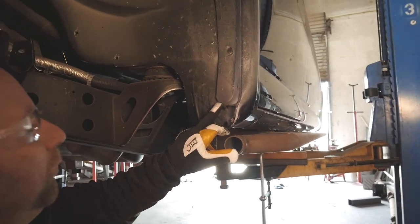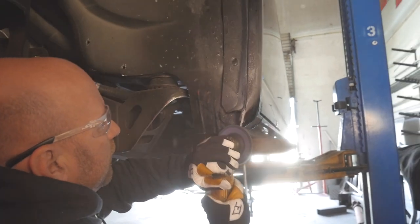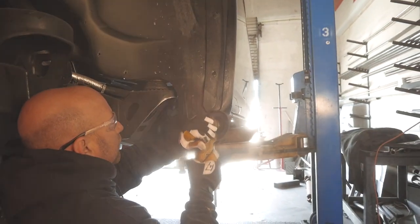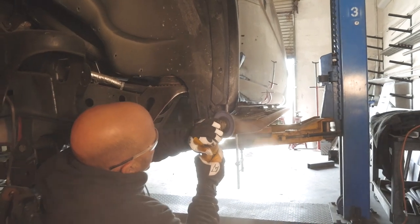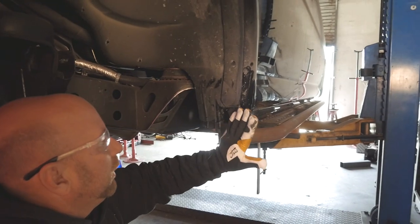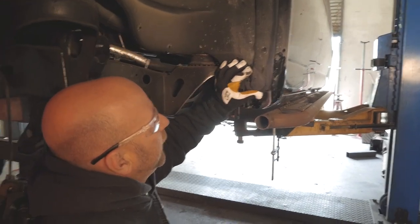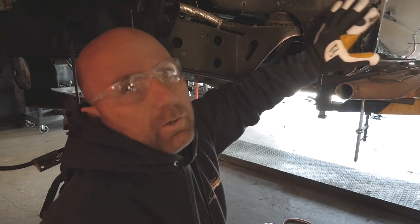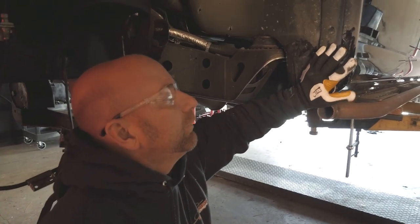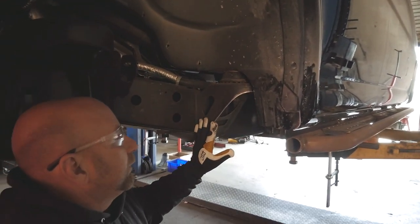You can see I made that cut go almost straight in there, so now when we clean this up it's going to almost look like it was all one piece. As you can see, that's just going to give you a little bit more on the turning radius. Another thing I'll also do sometimes is cut this flimsy piece at an angle. This mini fender is going to come off and we're going to put our mini fender on this — as you can see behind me a lot of this is already taken apart. This is one that's going to get our four-wheel drive conversion, so we'll be running our mini fender on this.